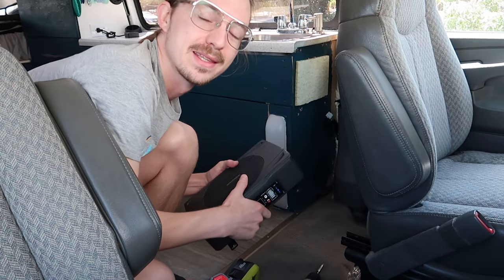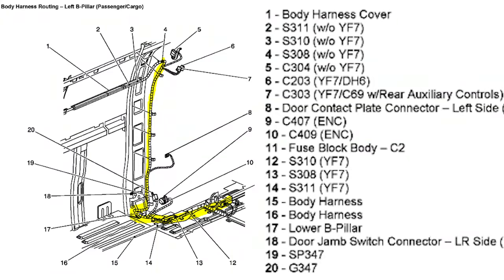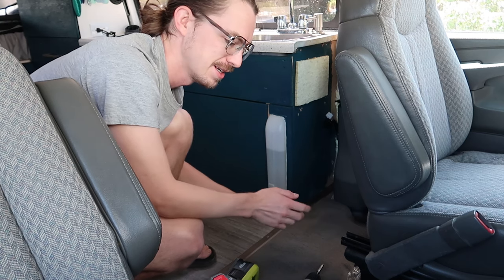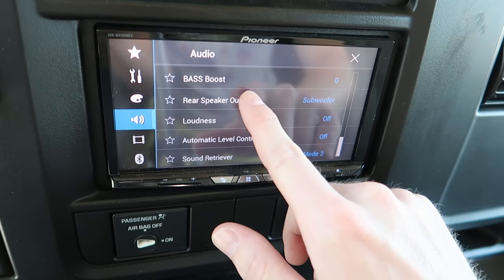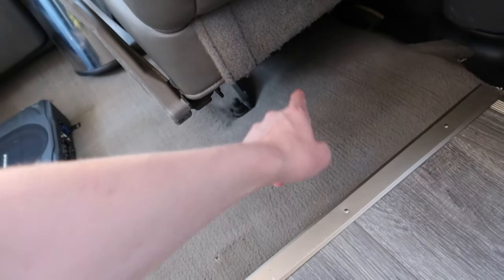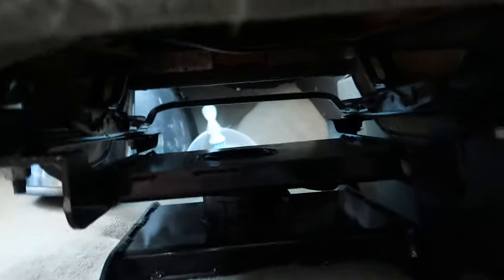The thing I really loved about this location was that all the wires going from the front of the van towards the back were already running up and down in this pillar. It had a dedicated heavy gauge, fused 12-volt positive, and both of my rear speaker outputs from the stereo going through here. This head unit also has a function where you can dedicate the rear speaker output to a subwoofer, which is exactly what I'm doing. I'll take off my transition strip and feed it up through there, pull the carpet up — there's a pass-through underneath. I can go up and put my subwoofer right on top. Shouldn't be any rattles from this thing.